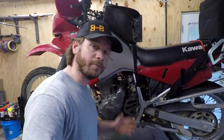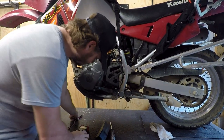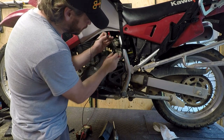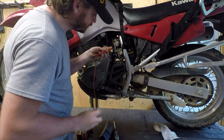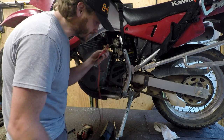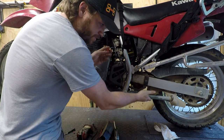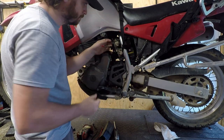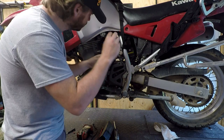All right, so we're checking out the side stand here. I want to show you how the system works. I have my digital multimeter set to continuity — it beeps whenever it sees a pathway. This is the plug for the side stand switch. You can see it has continuity when the kickstand is in the up position, which is what we want. When you go down, it breaks that continuity, it breaks the contacts within the switch. So since it has continuity in the up position, all we have to do is loop this pigtail and plug it back in.